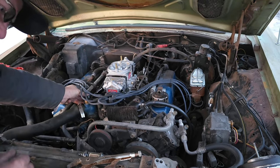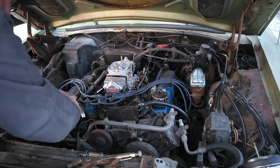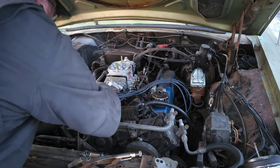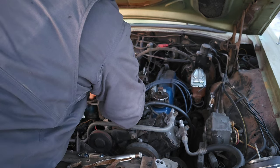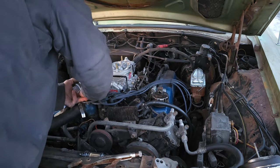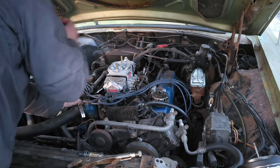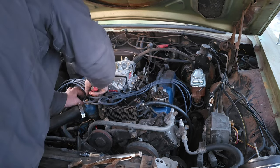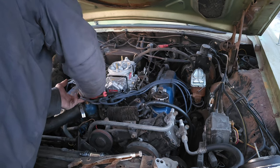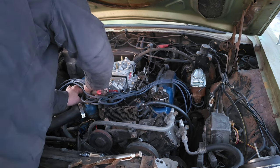I got a little hose cut off and the fuel filter placed down here — I just guesstimated on this hose and it's about an inch and a half too long. I'll probably redo it later with the filter sitting next to the coil and more out of the way. You want to check every little part for good clearances, get this hose all the way on the carb fitting with a good seal — you don't want gas coming out and catching you on fire. I also rerouted the coil wire because it was hitting in the way of my linkage.